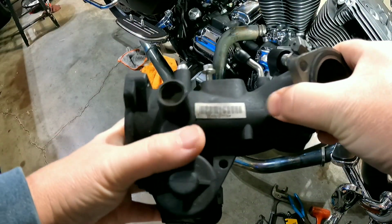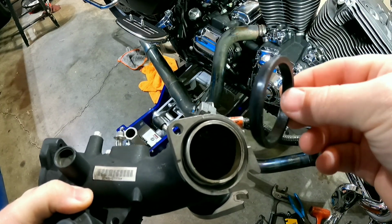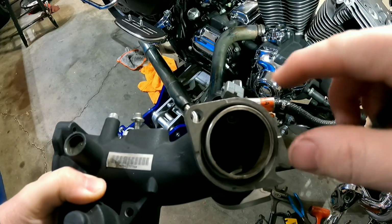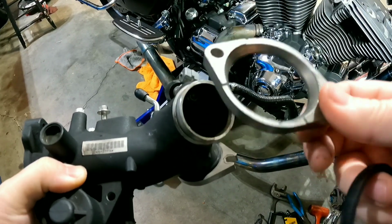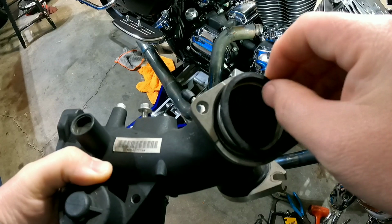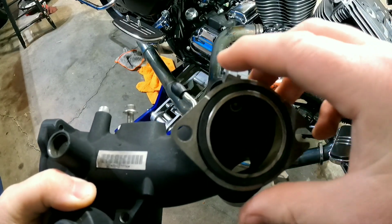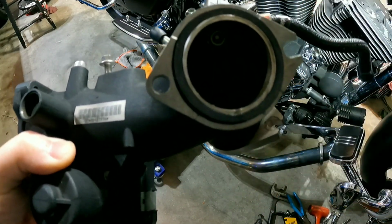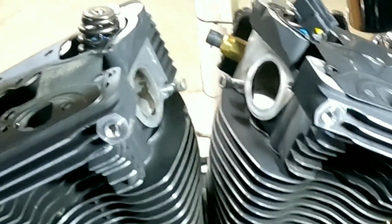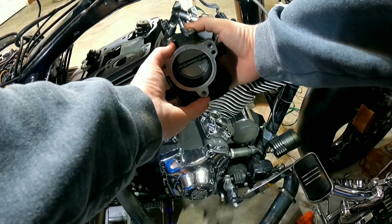Before you put this throttle body in, you want to replace these little gaskets. Now, it comes with little rubber O gaskets from Cometic. What they do, they're beveled. I don't know if you can see that very well. This flat piece will go towards the head side. The beveled side will go in this little groove right here. Now these obviously come off. They're kind of like an exhaust flange, if you will. But you just stick that on there and make sure to stick the beveled edge inside. Now I do have them lubricated. It's not super greasy or anything, but they are lubricated. And these move. And what you want to do is just slide it into place. These back bolts I do have installed. They do not have Loctite on them or anything as of right now. They're just there for guidance. So we're gonna guide those right in.